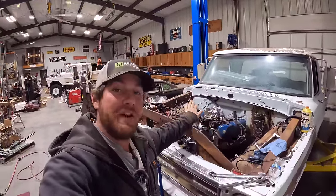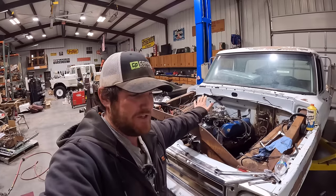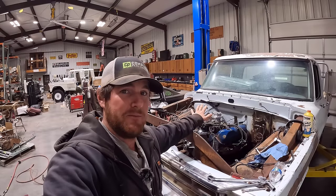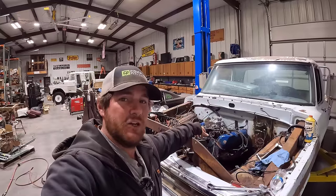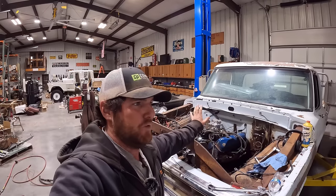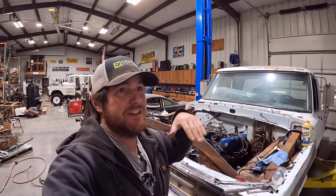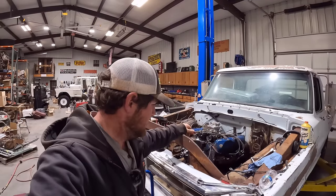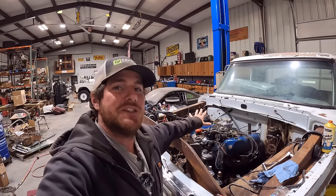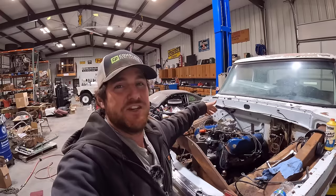We're working on the 360 today. I want to get it fired up in this episode and see if this engine is any good. On the last episode on this truck, we put this thing in here and I mentioned that I'm kind of taking a gamble on this engine because it was a runner when I took it out, but it wasn't running very good. The carburetor was leaking fuel somehow and making it run really rich and running very poorly. That poor running, very rich condition could be hiding other problems you couldn't necessarily tell because it was just running so poorly in general.